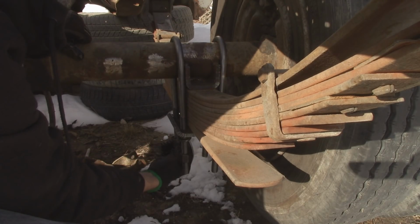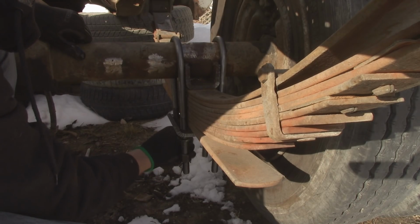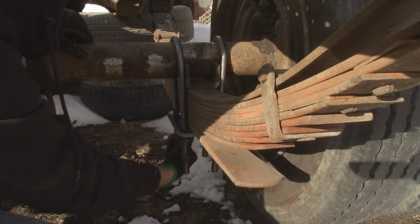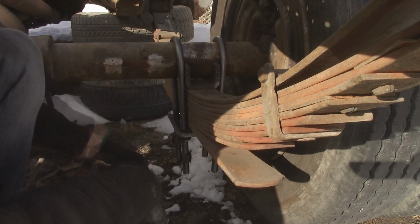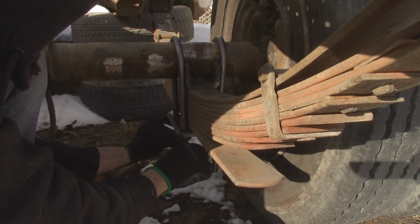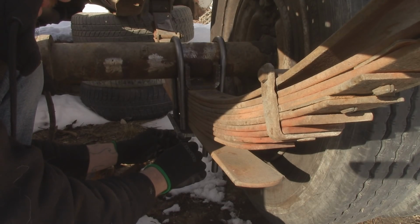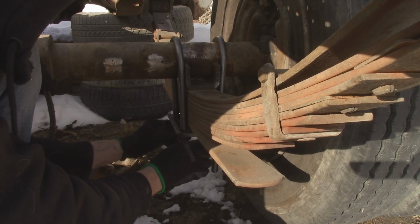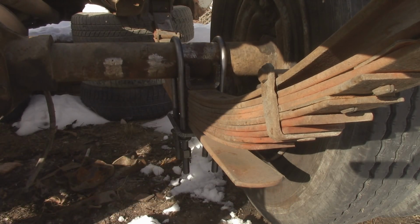I was worried about the battery dying in this thing, so I fired it up today. Threw it on a charger for, say, 2 hours on trickle charge, and then another half an hour on 12 amp. So, fired up. Sounds pretty decent. Do need some injectors for it though, because this is the throttle body injection. My brother-in-law Steve came over and showed me a neat trick using a timing gun to tell if your injectors are over-fueling, and that's exactly what's going on with this thing.